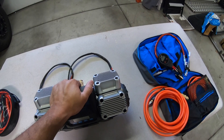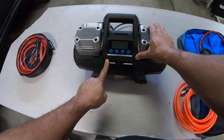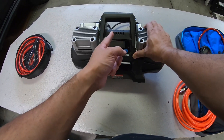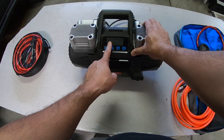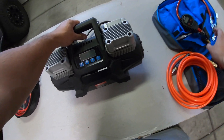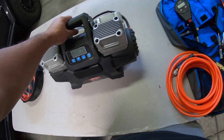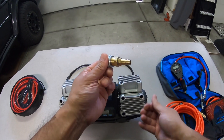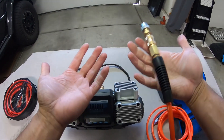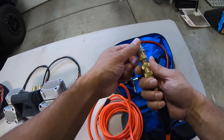The reason I carry two hoses and two inflators is so I can inflate two tires at once — the system is really fast. I can adjust the pressure cutoff switch settings. In the video you'll see on the left-hand side my target pressure and on the right-hand side the line pressure. I also have these little tools that connect directly to my hose line to the valve stem, so I can use the line pressure gauge on the inflation tool — that's a backup system in case my batteries run out on my ARB inflator.